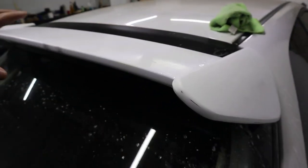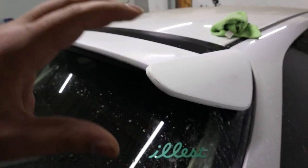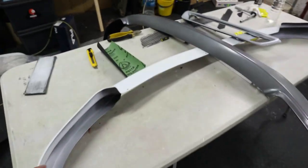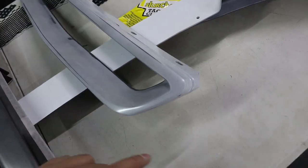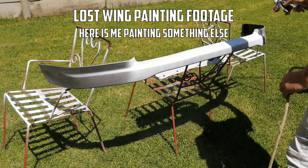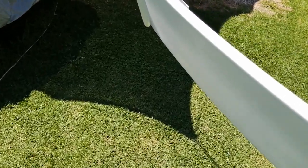I'm going to block-sand this out, sand out a small imperfection at the top, then take off the whole wing, sand the whole thing down again making sure all the edges are nice and smooth and those cast marks are gone, and then repaint it. This is a lot of work I didn't want to do, but we'll end up with better quality paint. We're also busy redoing the lip — this is the old one, this is the new one painted with plastic primer. I have a lot more thinners now and we're going to repaint everything again.